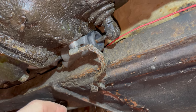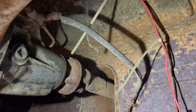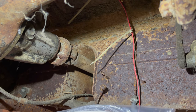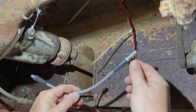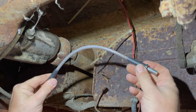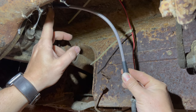This car has three brake hoses — one in the back and two in the front. I like to just cut the brake hoses so you can get a deep socket on and spin them off easily. I'm replacing all the brake hoses with stainless steel ones — I think these are Cobalt brand. The ends are the same as the original hoses, but they don't come with new fasteners, so you'll reuse your nuts and washers from the originals. Remember: only one side turns, so install the hose on the fixed side first, and don't forget the crush washer.